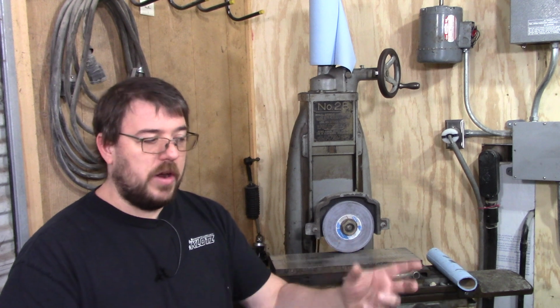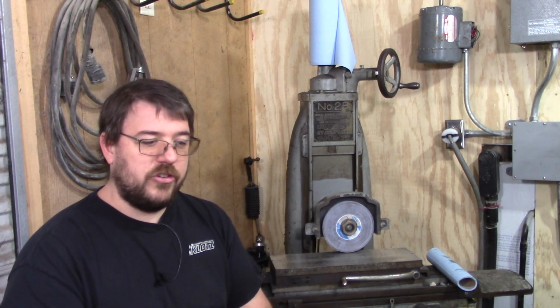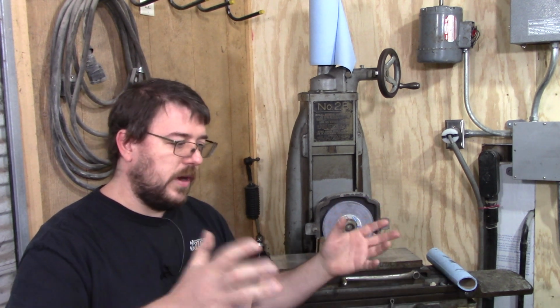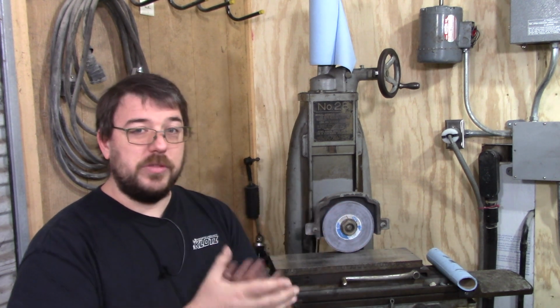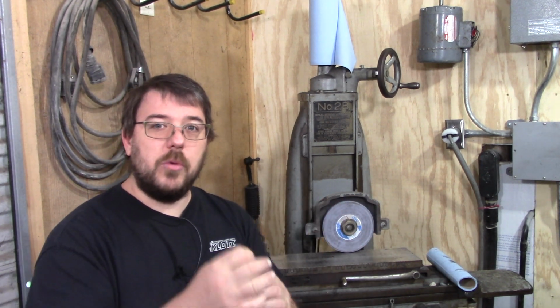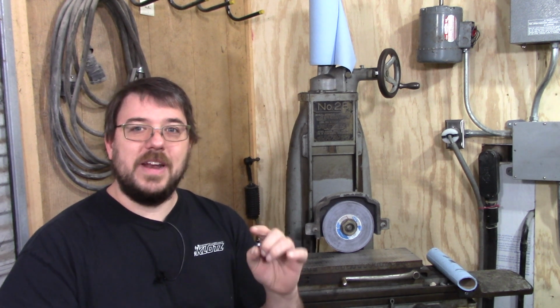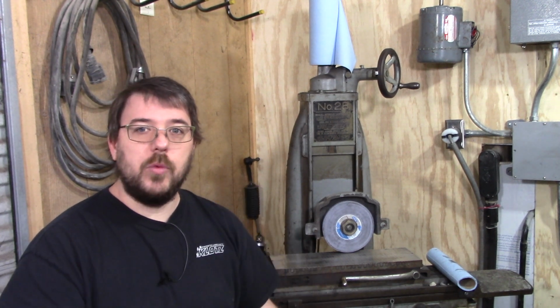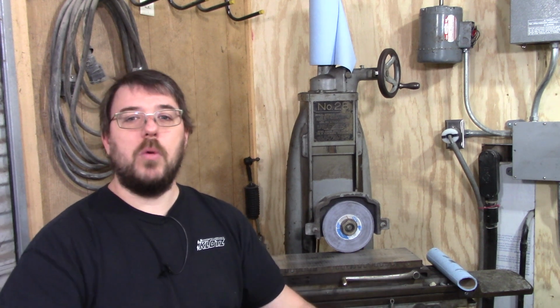We need to release a product to make solid lash adjusters. Solid lash adjusters are a bit of a maintenance nightmare because you have to disassemble the motor in order to shim it, and in this case with this motor, the disassembly required to get to those is really a pain. So I want to avoid solid lash adjusters, but if we have to, we'll know if we have to, and we'll know the kind of conditions that'll require them, so hopefully most people won't need them.